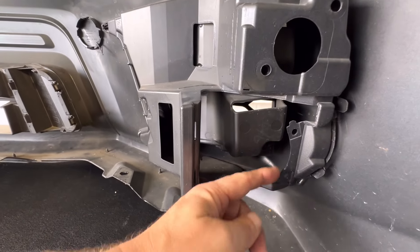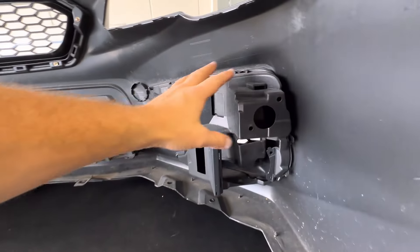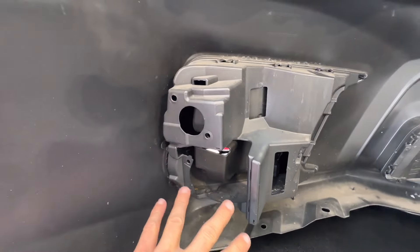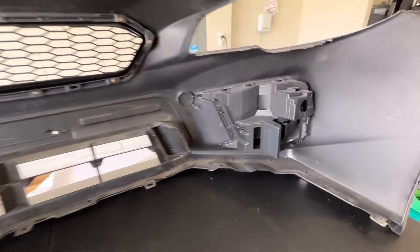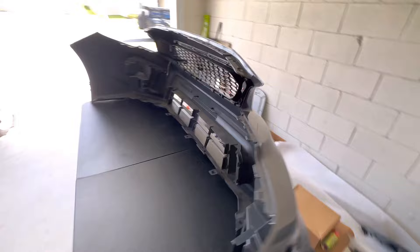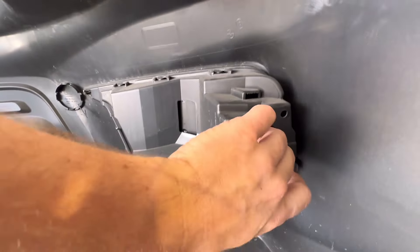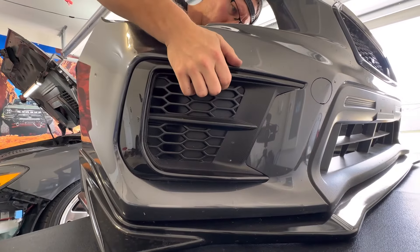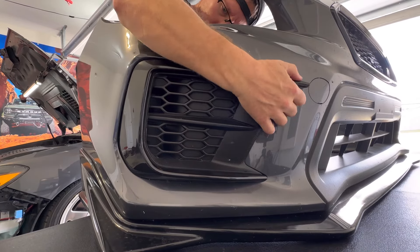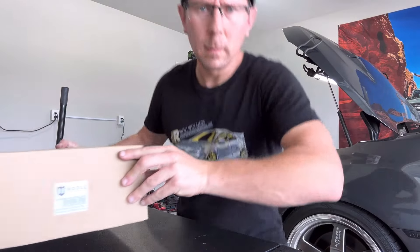The bumper is off and on the bench. One thing I'm excited to see is that although I don't have fog lights from the factory, the bumper itself is equipped to take the factory fog light — all the mounting points are here, just missing the hardware to lock it down. Same thing on the other side. All of the skeleton is here, so if I wanted to upgrade to fog lights in the future I definitely could. At this point we're going to go ahead and remove our bezels — they're just held in by plastic tabs so we can push out from the back and they should come right off.